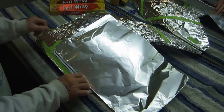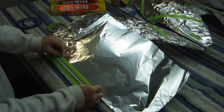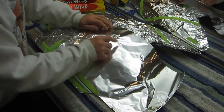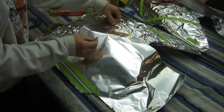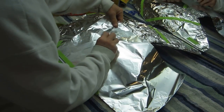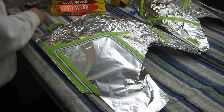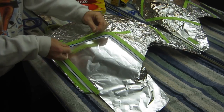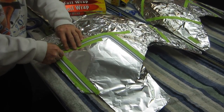I'll lay this piece in here and just tack it in place. That'll give me one edge, and this is a really nice little trick you can put in the bank for doing back masking. Not many people really look forward to back masking. That picks up the impression of where the tape is — now we want it a little bit less so we can put the tape in there. When cutting tin foil, you almost have to have a brand new razor every time — I guess the aluminum dulls the razor. But look how nice and neat that is for doing a back masking job.